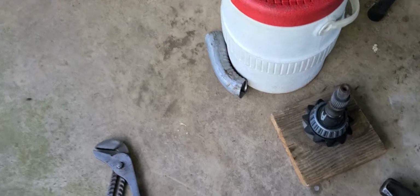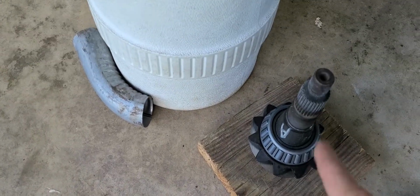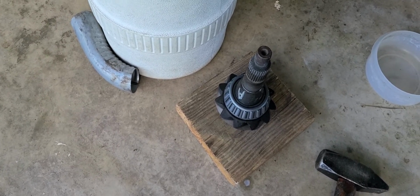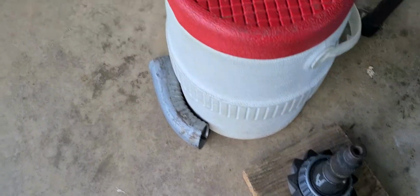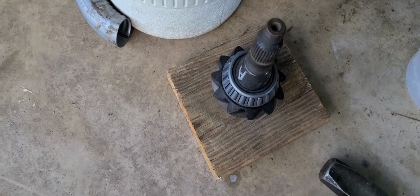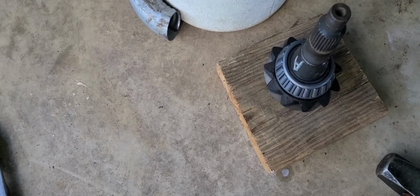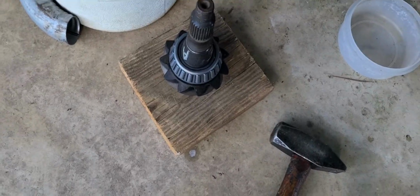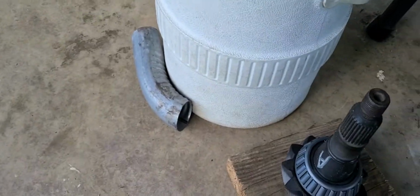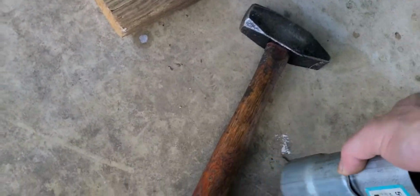And I had the pinion shaft freezing in my freezer overnight. And you'll see, very quickly I had it in the cooler. I got it out of the freezer, put it directly into the cooler with some ice packs, and then carried it out here. The pinion bearing had been ready for a few minutes. That grill got it really hot. Did a fantastic job. And as you can see, I pushed it on with my hand with these pieces of exhaust tubing.